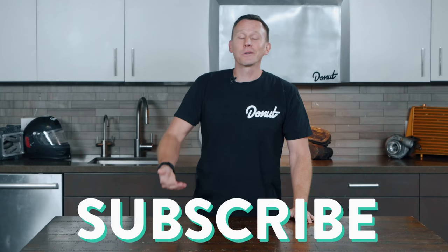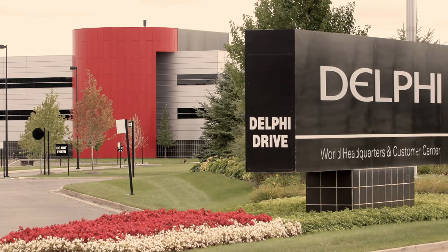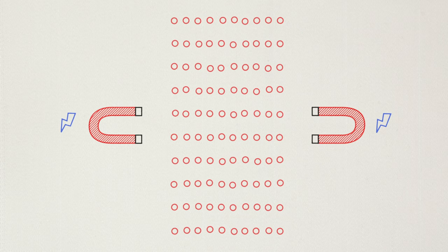Make sure you're subscribed — it means a lot to us and it's how we get to bring you new shows. This is where MagneRide comes in. MagneRide was developed by the Delphi Automotive Corporation for GM throughout the 90s, and it debuted on the 2002-and-a-half Cadillac Seville STS. MagneRide damper fluid is a synthetic damper fluid plus tiny little iron microspheres. When subjected to a magnetic field, the fluid greatly increases its apparent viscosity to the point of becoming a viscoelastic solid.